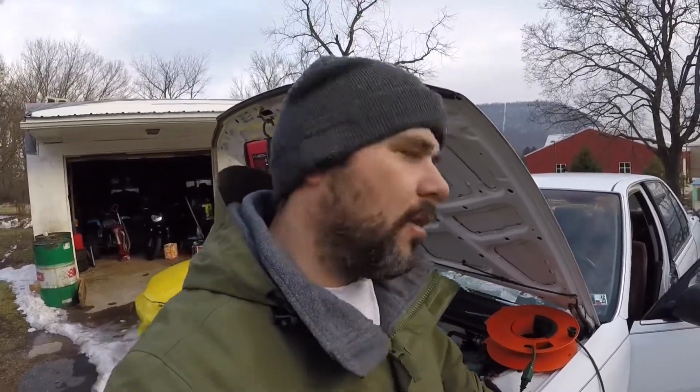So it saves you a little bit of fuel economy because it doesn't have the alternator working as hard, so it doesn't take as much energy to spin that belt. But on a car that's now approaching its 30-year anniversary, this car's 30 years old this year, these systems start to fail. A lot of people would say, hey, just throw a new alternator on here, but it could still leave me with the same exact no charge problem. So what I have to do is first go through it and make sure that it is my alternator that's bad and not the electronic load detection system.